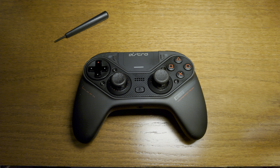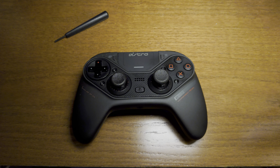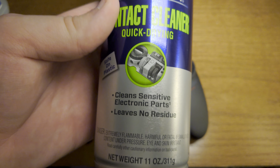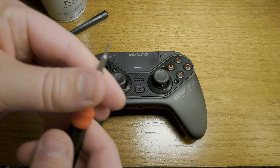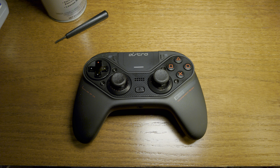Do this with all your controllers. Stick drift often occurs because of dirt — stuff gets stuck in the joysticks and prevents them from moving correctly. This works on a DualShock 4 or any other controller. I've started cleaning mine every month or two and it has prevented stick drift, so if you're in a dirty environment, make sure you clean your controller. To recap the materials: rubbing alcohol 90% or above preferred, WD-40 Specialist contact cleaner for sensitive electronic parts, a few Q-tips, and a T6 screwdriver. Thanks for watching — please like, comment, and subscribe!